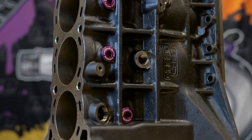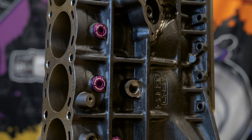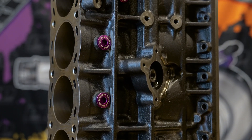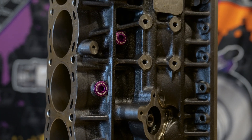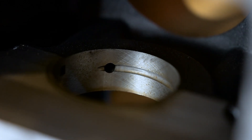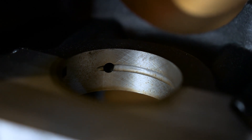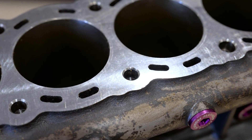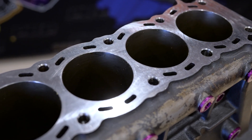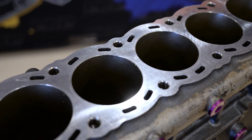So, the block. I know you're all eager to find out when you can have it. This is our first R0 block. This particular one has got an R1-sort-of-version brace on it. This has all been tunnel bored and it's ready to go. We've also done the deck work and all of the cylinder bore work. Got a couple of oil galleries to go and we're pretty well ready to run this.